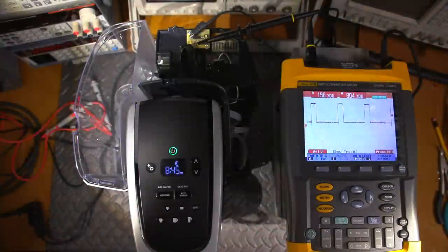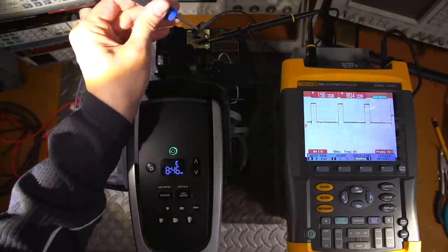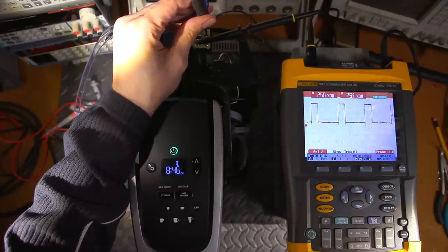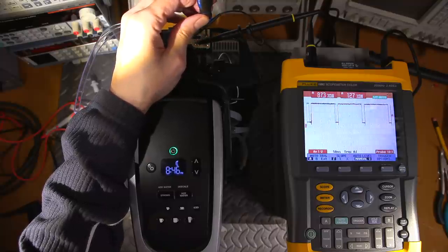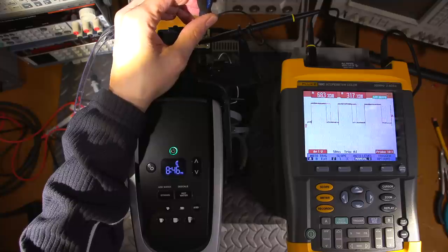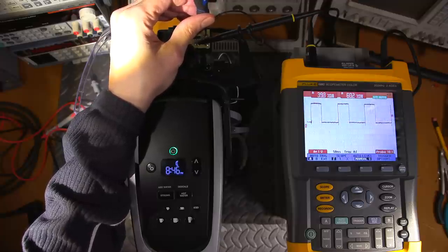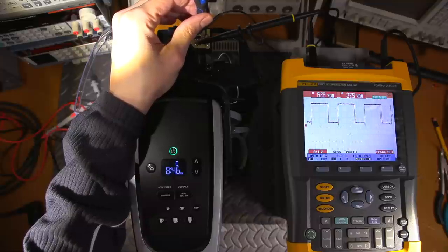The adjustment is right here. I have water in it and the cup in here. The little circuit is installed and is creating a very nice signal. Let me adjust this - there it is. Let's take a look at the PWM - isn't that nice, you can turn that right up to DC. It's bottoming out at about 9.5 percent. We're around 60 percent duty cycle - let's try that 60/40 and see what happens. It's a very touchy control.